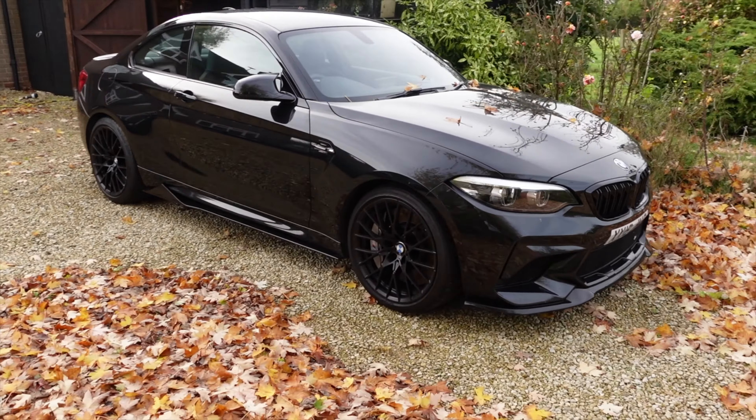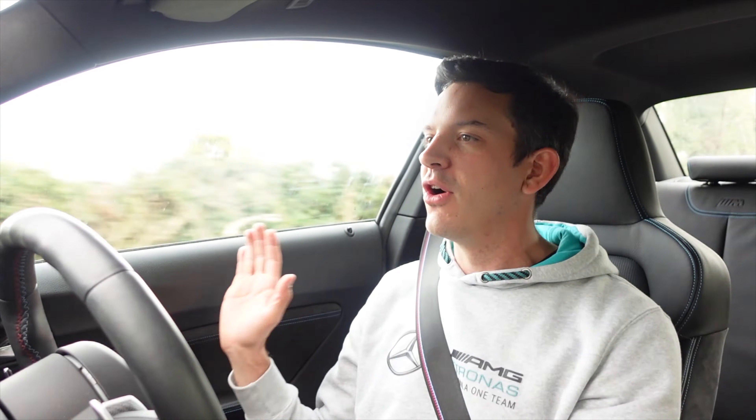As I did it, I just wanted to give the engine bay a bit of a glow-up — it was looking a bit dull in there. One downside I've found: if you've got an M2 Competition you'll know how the car can kangaroo in low-down gears in MDM or sport mode. With this intake, in sport mode it does that very, very slightly even in normal driving mode. I found it at very low speeds in car parks — it was jolting slightly, kangarooing. It's not anywhere near as bad as it is in sport mode on the stock intake, but it was very slightly there. It wouldn't stop me; I'm not about to remove it because of that — just something to be aware of.